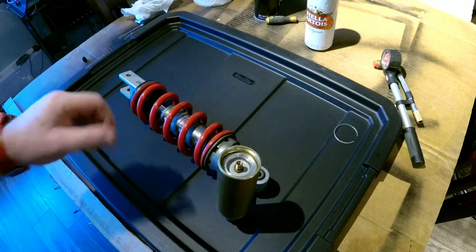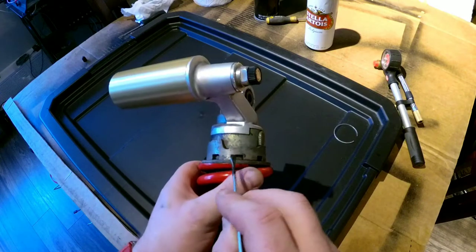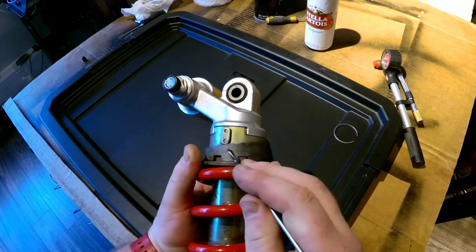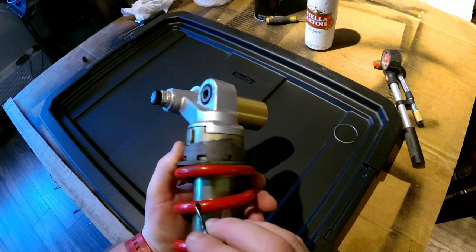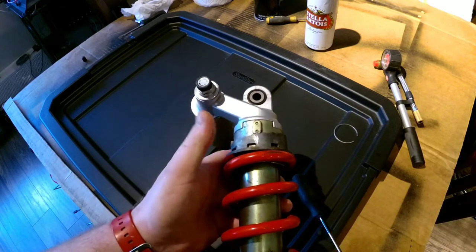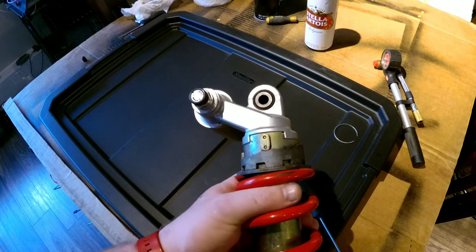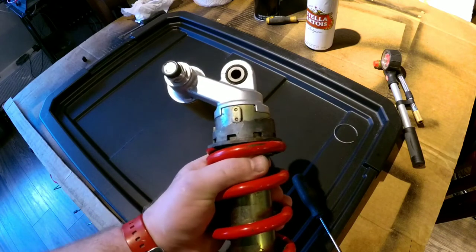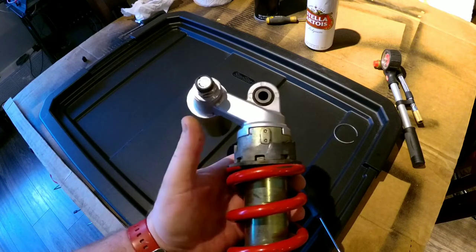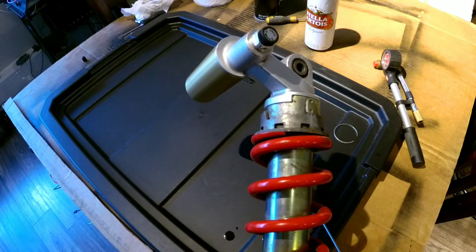Okay, we got the one ring. Good thing to remember, we got 1, 2, 3, 4, fifth ramp, 6, 7, 8, 9, there are nine of them. The fifth one is the one I enjoy the most. It's a pretty wide range of weights, I guess 180 to 220. I'm heavily over 200 for sure right now. So let's mark the ramp, make sure we can go back to it, and we'll need to remove the preload from the spring.